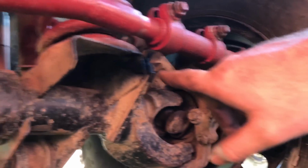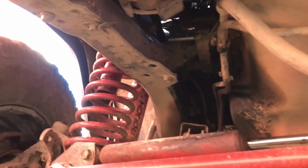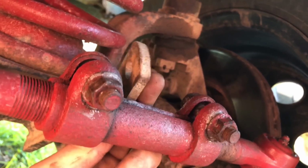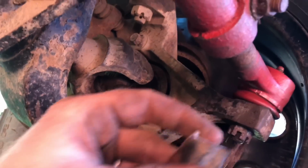This is your sway bar bracket, which as you can see over there, it's just like that. It's just over here, up in here like this. This was hitting it, and then you cut it off. As you can see, I just notched mine, and it clears it just fine, as you seen there a minute ago. But it's the only modification you have to do. Like I said, you can weld that around it if you want.